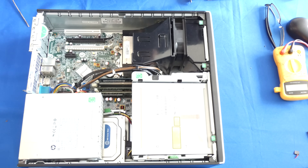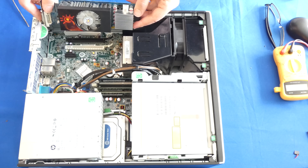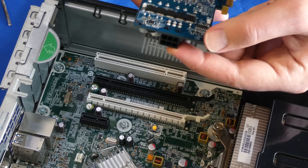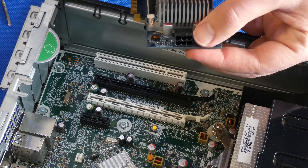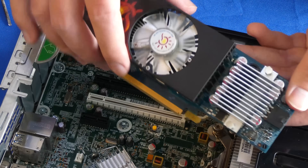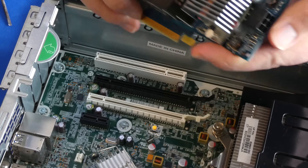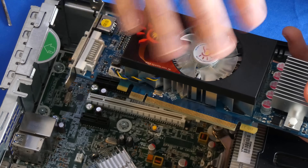So this is why we're going to put that one aside. Now we've got the proper size that we're going to install right here. Before you purchase one of these, make sure that it does not have a requirement for an external or additional power source. This one actually does, so I'm going to need an adapter. This is why I'm going to put a link in the description box to the type of video card that you don't need additional power — you just put it in, install the drivers, and then you're done.